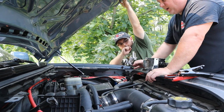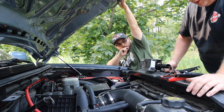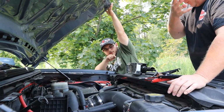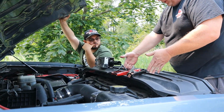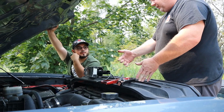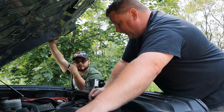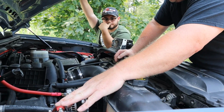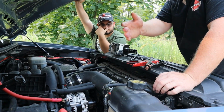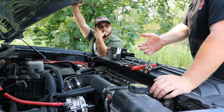So that's why your fuse box in the interior acts like it has power. It's because it's off of that. Yeah, this battery. You can test the battery, right? You can test the negative and positive and see what that's at. If it's at 12.5, this should be 12.5 here. Okay. This should, because it's coming right from the battery. Now, if it's less, that's telling me there's a resistance between A and B. It shouldn't be much, if any at all.